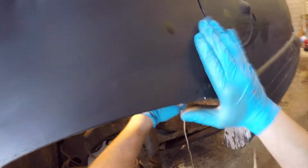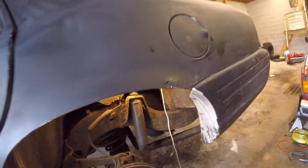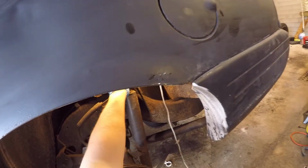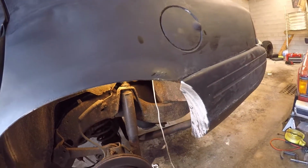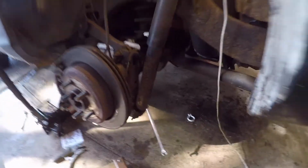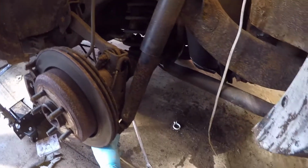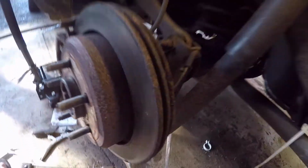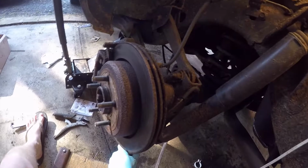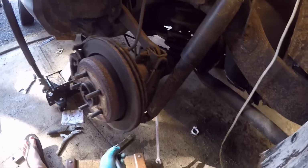Looks like that's immediately spinning. But if you see on this little center thing, actual threaded part of the shock, we got some flats. Let's stick a vice grip on there and keep going. So after quite a bit of time, got this top shock mount off. Now it's time for the bottom. It is a 15 on the bolt side and a 19 on the nut side. Is it a 19? It was a 19 on the other side. Looks like that's good enough.